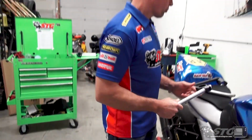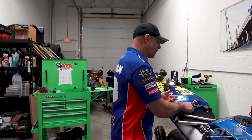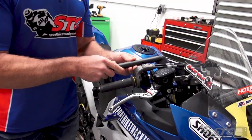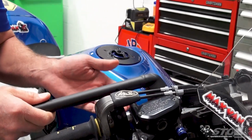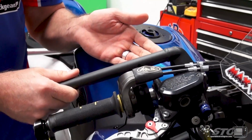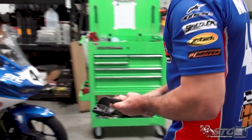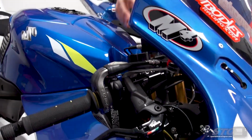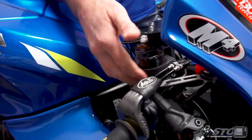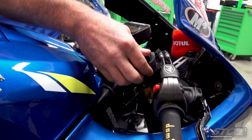It's also important to point out every bike's a little bit different, okay? On the Ninja 400, your clip-ons are on top of the triple tree. The Yamaha R3 is the same way. Now you look at a bike like the Suzuki GSX-R 1000R over here, the OEM clip-ons for this bike will be under the top triple tree.